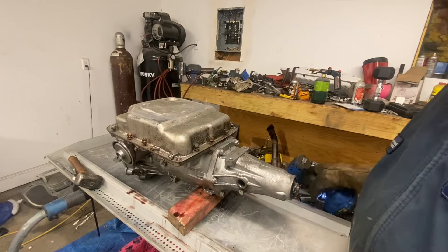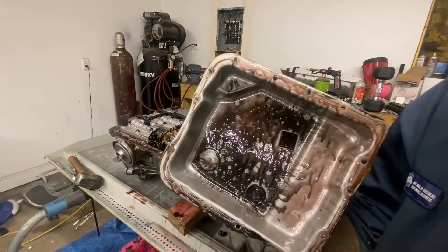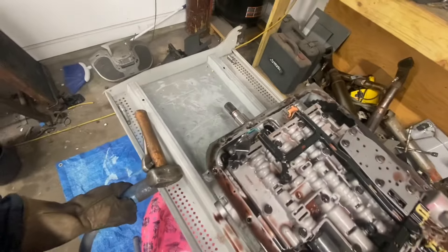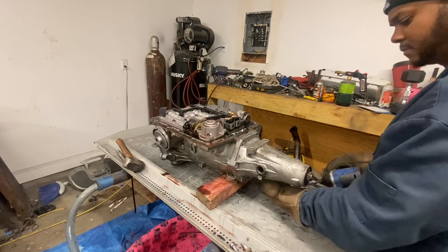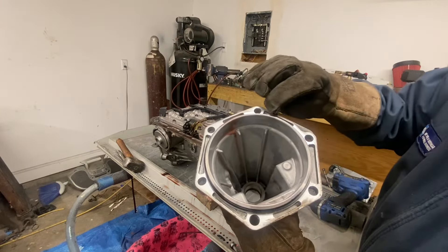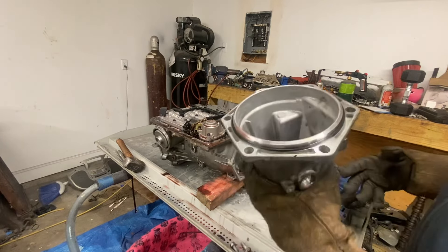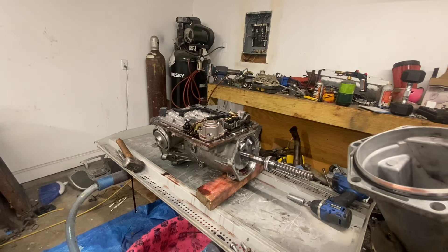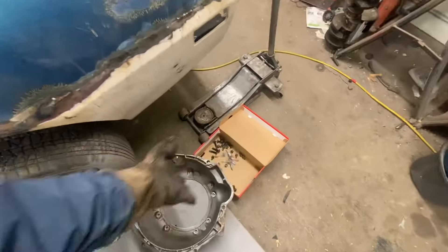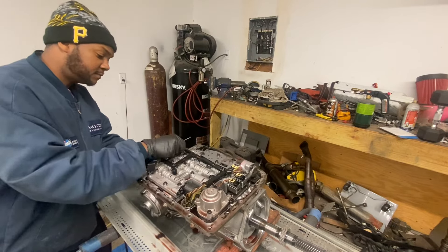Y'all see the pan. Y'all see why we're rebuilding it. Y'all see anything that don't look right, just let me know. You see that seal up on there? Now some of these parts that we're gonna take off of here, we're gonna mark them. We're just gonna focus on getting this harness off of here — just get the harness off. I think this one here has the PWM solenoid on there — gotta pull that out because it's still connected, it stays with the harness.